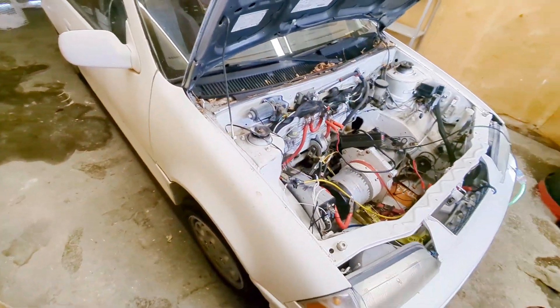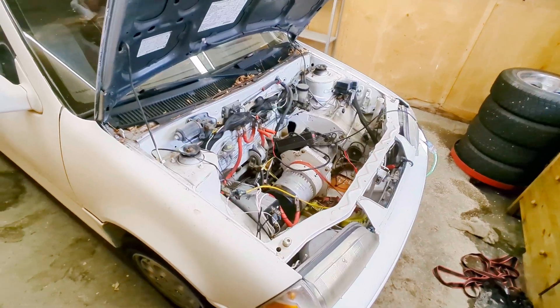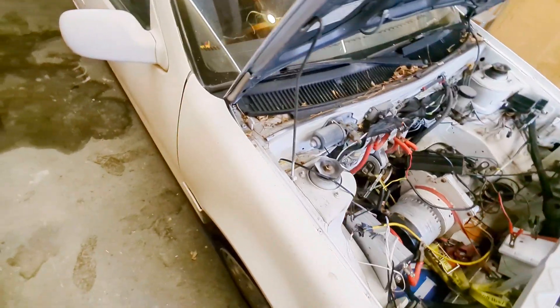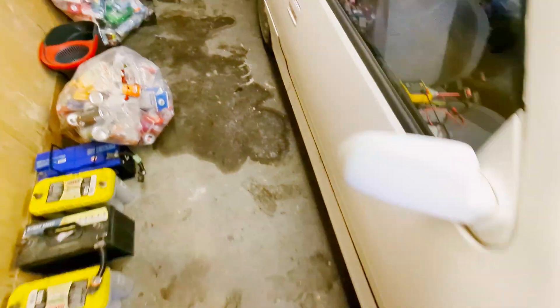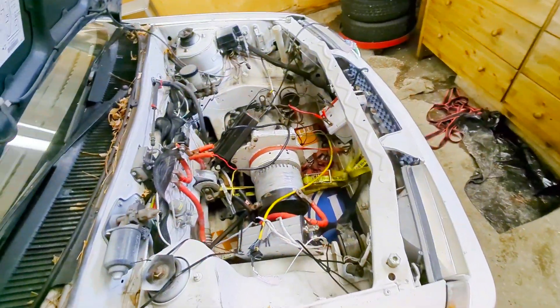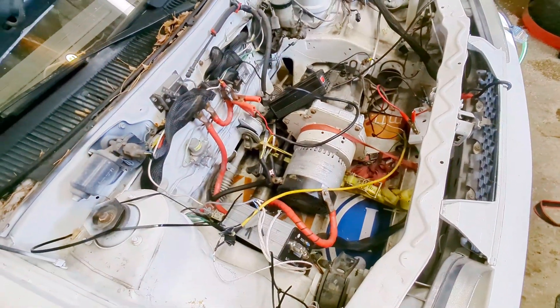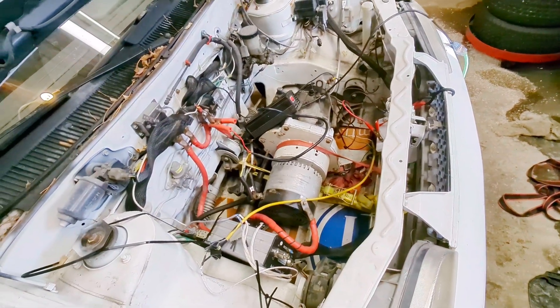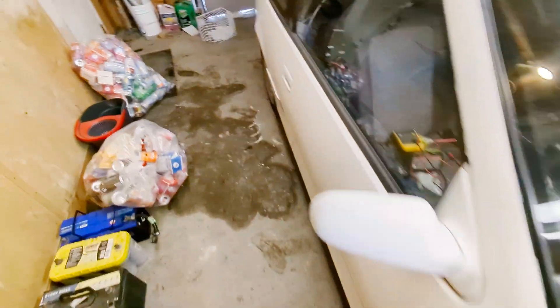The batteries will get encapsulated with heating mats underneath. This should be a runabout with a top speed in the 80 to 110 kilometers per hour range depending on tire size, and depending on how much RPM I can get out of this motor. It's rated between 2800 RPM loaded and 3700 RPM unloaded, and I just don't know what I'll actually see out of it.